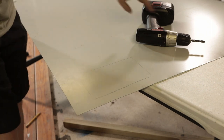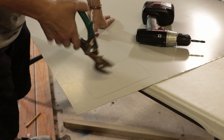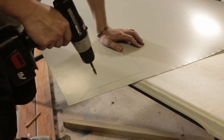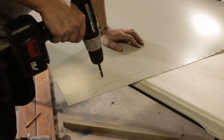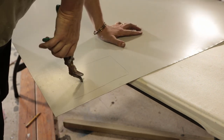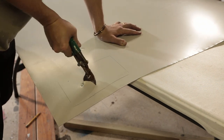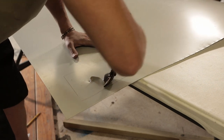I've got my hole marked out for my taillights. Obviously I can't just take the tin snips and poke through and start cutting, so what I need to do is drill a pilot hole to give the snippers something to bite into — a little hole so I can start cutting around and get to the edge. I don't want to drill this hole at the edge because it'll make the surface not flat, and we definitely want it flat if we want to seal properly. Now that I've got the hole, I've got just enough to get the snips in there and start cutting, working my way toward the edge of the hole. We are at the point now where we've got all the hardware in where it's supposed to be — this is just a dry fit right now. We're not going to mess with the adhesive quite yet, but we need to make sure everything is exactly where it needs to be. This is our new shiny metal and we've got our lights in place and hardware where it's going to be.